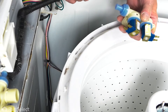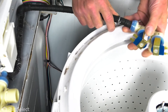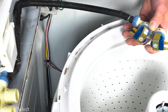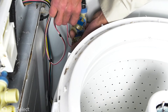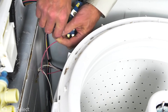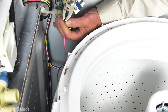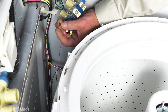We'll then take the new valve. We'll fit that hose onto the outlet and reposition that clamp. We'll next take our wire harness and reconnect the wires to the terminals on the solenoid. We also need to make sure that these wires are tight on the terminals and if they appear a bit loose, just take our pliers and give them a little crimp and then put them back on.